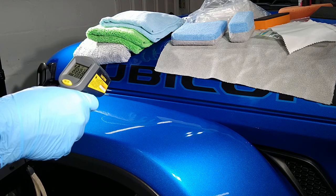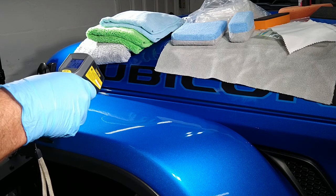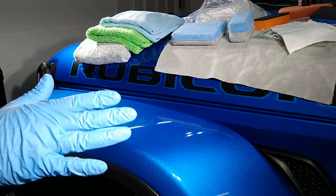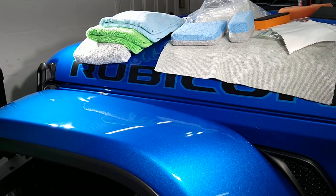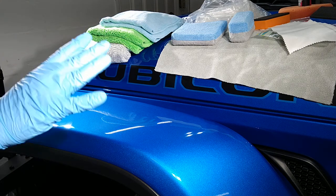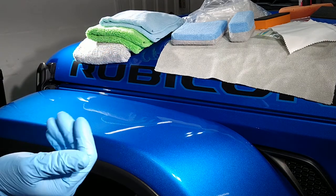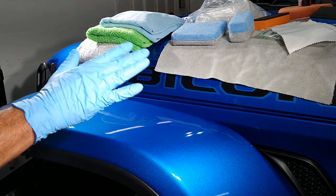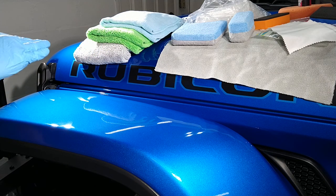You do want to know your surface temperature. It is 83.5 degrees — that's going to make a difference in how quickly the coating is ready for leveling. There's not so much of a rainbow flashing like some coatings have; with this one you go by tacky feel — it's more of a tactile indicator of when it's time to flash. It has a very long flash time in proper conditions. In the low 70s with low humidity, you might go 20 minutes before you start to remove the transfer material or solvents that separate from the actual coating. There's a carrier in the solution.